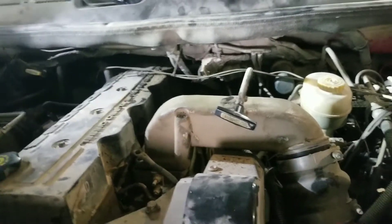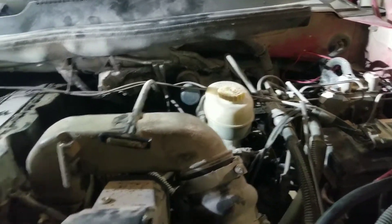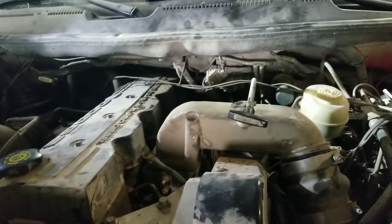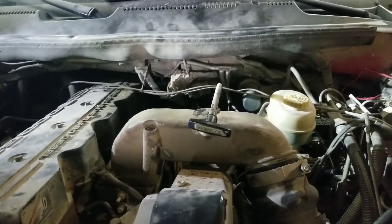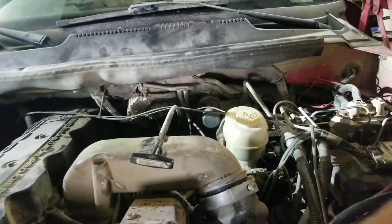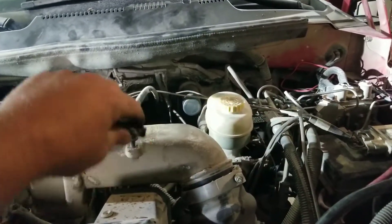They can be kind of tricky. First thing I did — I already did this — I took these intake bolts off. This truck has a programmer but it doesn't have a proper port on the intake anywhere, so we're going to put a port in the intake horn. I pulled the bolts off the top — four of them right around there — and pulled the dipstick tube off.